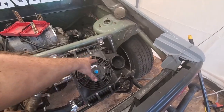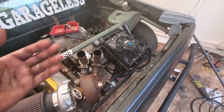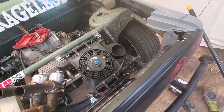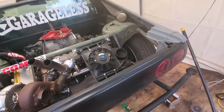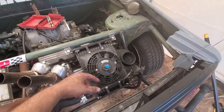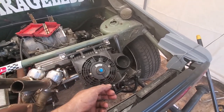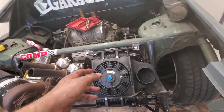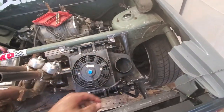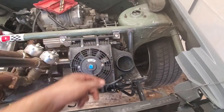I did some research - ideally straight up and down is most ideal for the fittings. Trying to figure out which port is supposed to go where - from what I found, it doesn't matter all too much. But the argument is: if you have it go to the bottom like this, when you shut off the car it's gonna drain your whole oil cooler back into the pan, making it hard to tell your oil level. You can make your line go up over to create a high point, or go to the top instead.